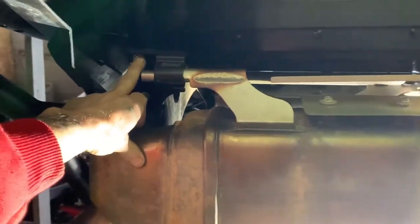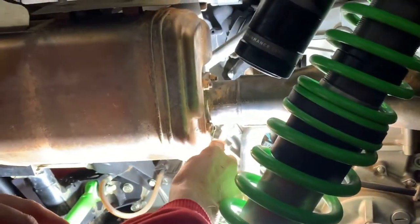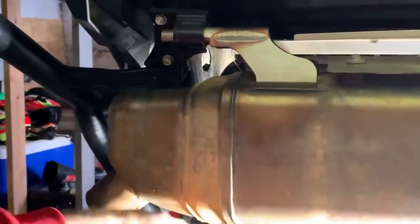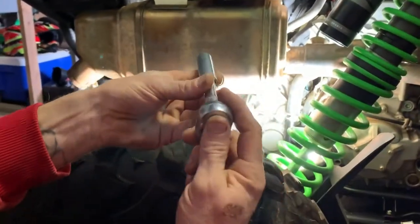There's a bolt there, a bolt down there, a bolt here, and a bolt here. And then you've got your flange bolts — that's what holds the stock muffler on right here, and there's four of those. These right here are 12 millimeter, so you're going to need a 12 millimeter wrench. On this upper mount right here you need a 14 socket with a long extension. On these back mounts — the top mount and bottom mounts — it's a 12 millimeter too. So let's go ahead and break all the bolts loose. Get a 12 millimeter and break all these loose. There are four of them. Save all your hardware because you're going to have to use some of your bolts when putting new brackets on.